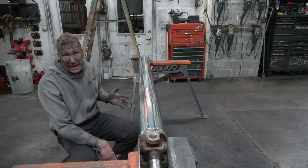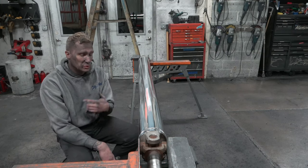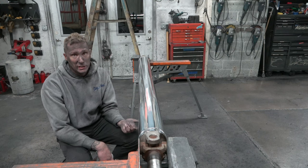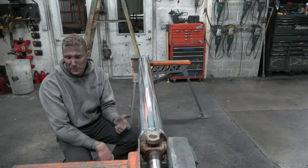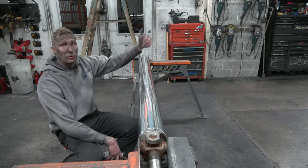Now you could break it up in half if you wanted to, do half and half, but I always do two multiple cuts. So I do an orange and brown, and then I'll come back with either a secondary orange and brown or a yellow and brown. In this case, this one's in really good shape, so I'm gonna come back with it now with the yellow and brown. Now you saw I polished from this side going over to that way.